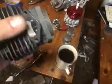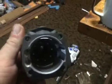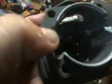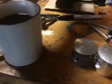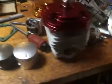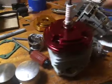There's an even bigger one that we can go to. Hold on there. This one is another one that I was looking at doing. This one's a 58 millimeter bore. But the bigger you go on the bore, the less transfer you get. So at a certain point, you kind of got to stop. So I think I'm gonna, normally I fill the cases here